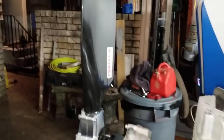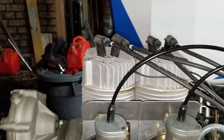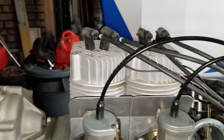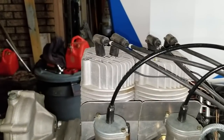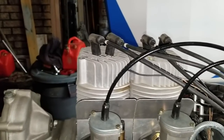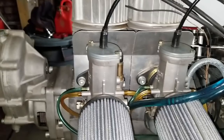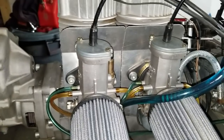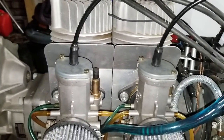We re-pitched the prop and we're at 10 degrees right now, which is giving us about 5,180 RPM. But I was still getting cylinder head temperatures of 540, 550, 560 on the high end of the throttle — around 4,800 to 5,000 RPM is where we were getting the high temps. I thought we had it licked with a carburetor needle valve adjustment, but that only affects the low end, so I was just spinning my wheels on that.